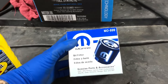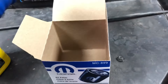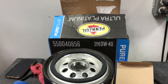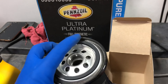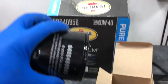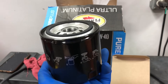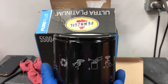Of course we got our Mopar filter. Not everybody does this, but on filters that are mounted in the upright position, I like to try and pre-fill them with a little bit of oil, and of course we'll put a nice little film of fresh oil on the seal. When filters are mounted sideways or at an angle, I don't pre-fill them because it's just going to leak new oil everywhere — but whenever they're upright, definitely put a little oil in them to give them a bit of help on that first initial startup.